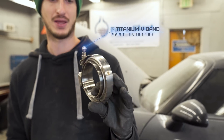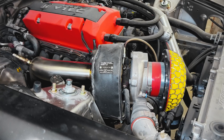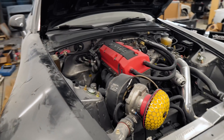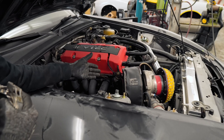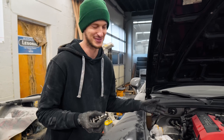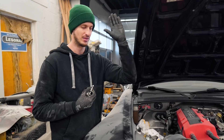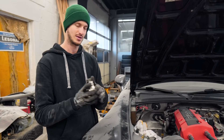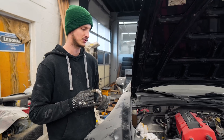If you look at Xavier's GTX turbo, it has a very specific discharge flange, and I don't think Vibrant makes that. But there are other brands that make titanium V-band flanges specific to turbos like his GTX 30. It's on a full turbo-back titanium exhaust. Sometimes big Borg Warner turbos will come with a Marmon flange — it's a very weird, like a tractor flange. I don't know if I could even find a titanium discharge flange to match that, so I would cut the whole flange off the housing, same thing I did at Tim's, and get a generic one with stainless on one side, titanium the other side, and weld the stainless to the cast turbo housing. And you can go from there — saves you time.